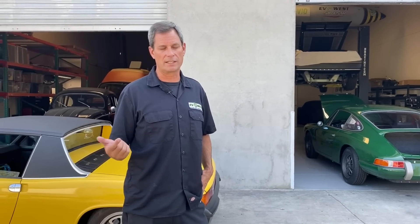We took a look at the rear, the front, the battery box and subframe, and had it up on the lift — so now we're going to go take it for a drive. It's a great day for a drive and these cars are just incredibly fast. We sold one of these kits to BC Moto, and he's one of the first we know of to put a measuring device on it — he's getting a 2.06 zero to 60. This car has a more era-appropriate tire on it so we won't get acceleration like that just because of grip, and it's not wide-bodied. But suffice to say, the 400-kilowatt Tesla drive has more than enough horsepower for the Porsche. The Porsche is sitting at about 2,450 pounds post-conversion — about 45% up front, about 55% in the rear — so we preserved a little bit of that rear bias, and it actually helps the car hook up a little bit better.